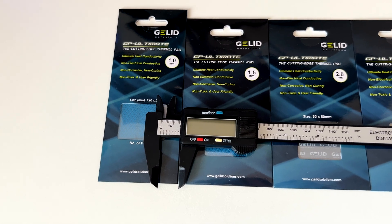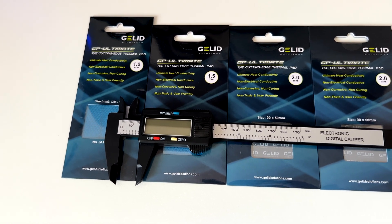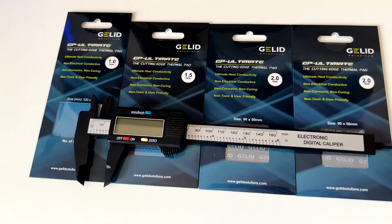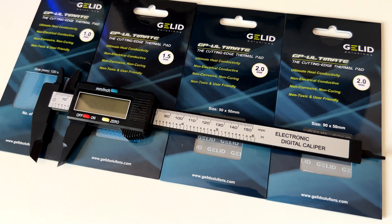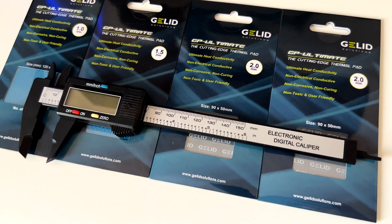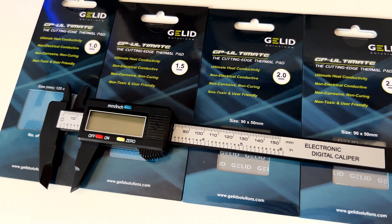For preventing issues, I will try to measure with a digital caliper the thickness of the actual thermal pads. If I'm lucky, some corners of the pads might be safe and not squished. I'm aware this isn't the most accurate way, but it can be helpful just to have an idea of the thickness.